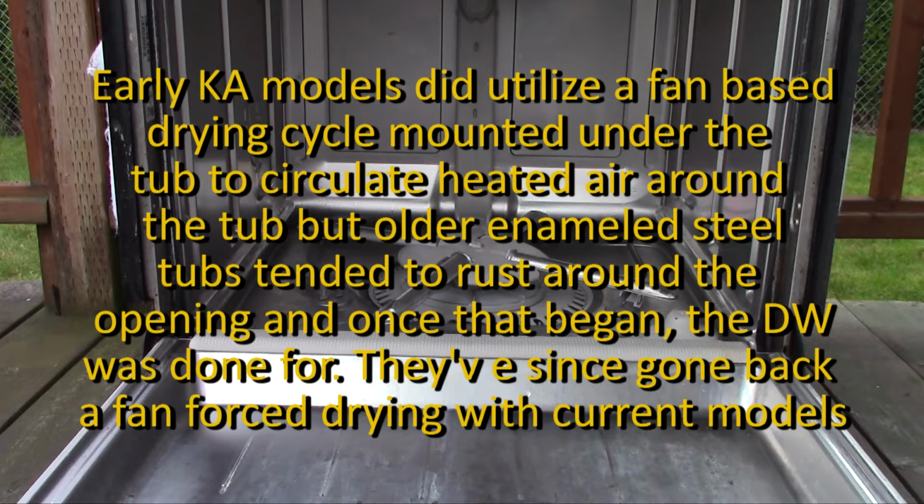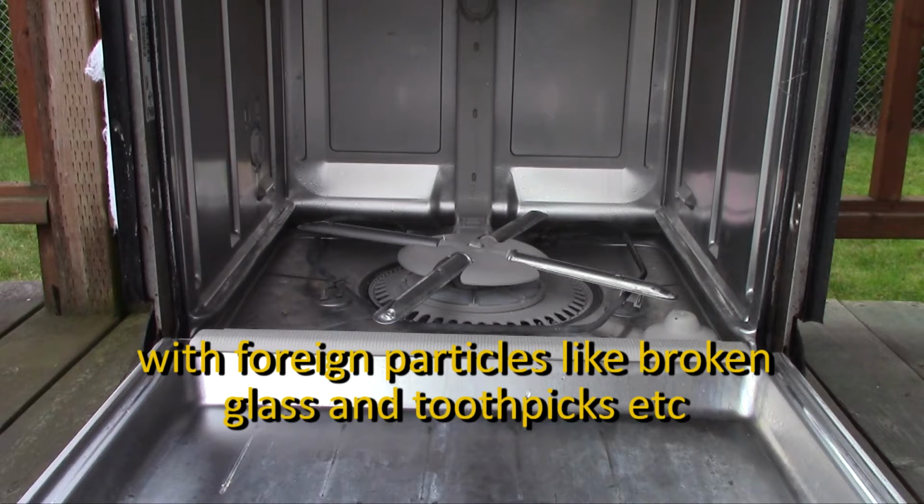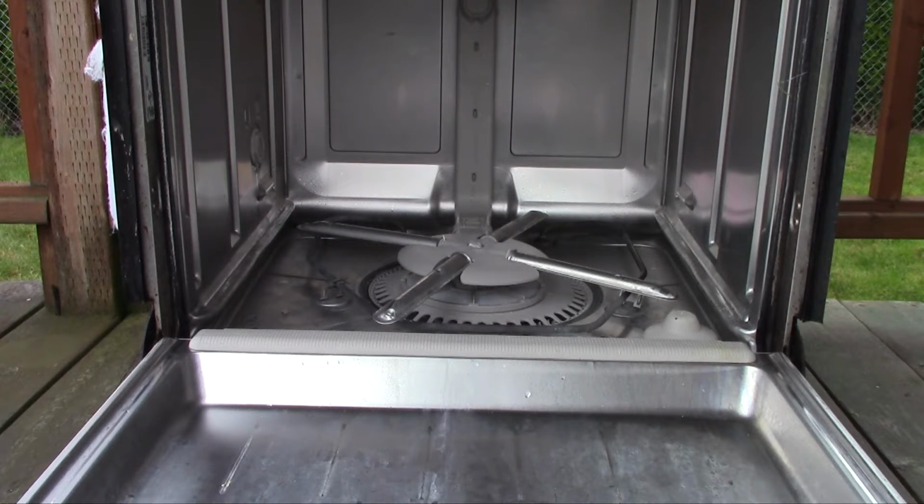This particular dishwasher and many older U.S. dishwashers has what's called a food disposer, and those are supposed to be relatively maintenance free. It doesn't mean they're maintenance free literally, but you should not have to clean them out once a month, or as little as once a month. You might have to periodically get in there and take it apart and clean it out when it's got debris in it. Basically what happens is when you break a glass, that shard of glass has to go somewhere, and it'll end up down there, and it will impede the water flow, because the sump, when it plugs up, will reduce the water pressure going to the upper rack, which is some of my problems with this dishwasher.